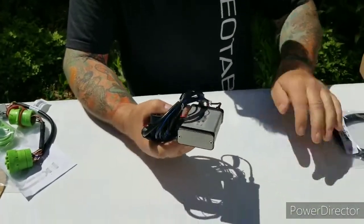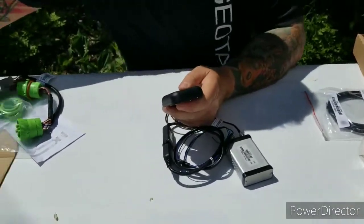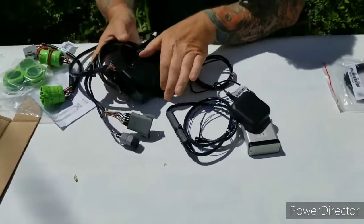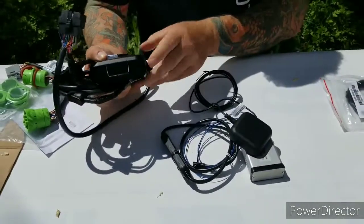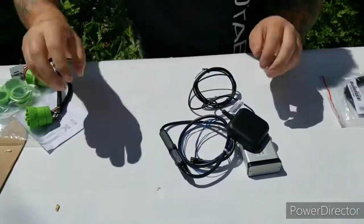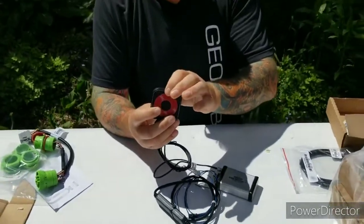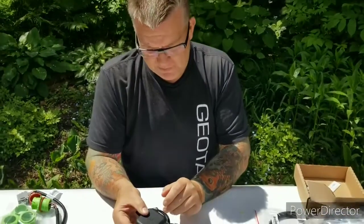Now the satellite device, don't confuse the satellite antenna with the top of the Go Rugged device. They are not the same thing. The Go Rugged device requires no external antenna. It can just go into the vehicles upside down, right side up, behind plastic, behind the firewalls of the vehicles. But the satellite device, when you affix this together, must have a clear view of the sky. So please clean a glass surface or put it somewhere where it can have a clean view of the sky.